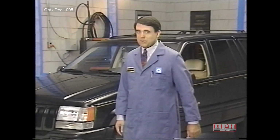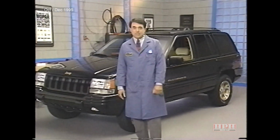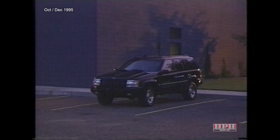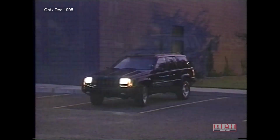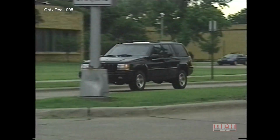We've already discussed many new body electrical features, but there are still a few that we haven't covered. Let's start with the headlamps and work our way toward the rear of the vehicle. If the vehicle is equipped with auto headlamps, the lamps will automatically turn on in low ambient light after the engine is started. The lamps turn off once the ambient light sensor indicates sufficient light.